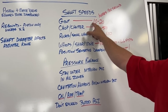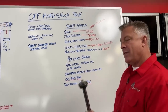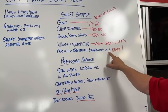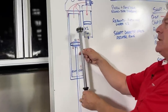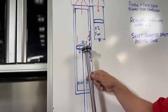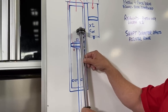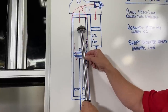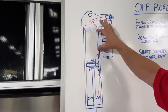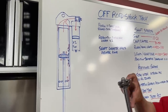But in the one spot where shaft speed is as low as possible — in a big g-out where you need to stop the vehicle from bottoming all the way out — the piston valving probably won't open. That's when position-sensitive damping comes in. Position-sensitive damping means that at a certain position inside the shock, damping is changed or controlled. In a bypass shock, you have bypass ports controlling some of the feel, plus piston valving controlling ride quality. But as soon as this piston passes the last bypass port, it enters what's called the bump stage.